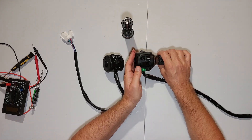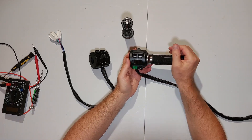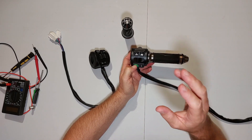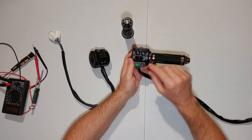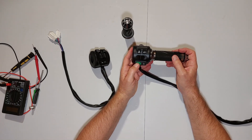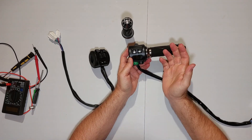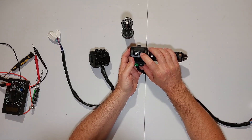On the right side switch you've got one, two, and three settings for speed — if your controller has eco, normal, and sport mode. There's an S button which can act as a sport mode; that's a momentary button, it doesn't latch. There's also a momentary reverse button — it might work with some controllers, it might not. Then you've got latching buttons for sidelights.